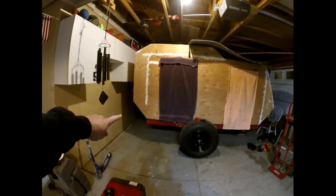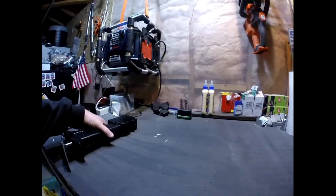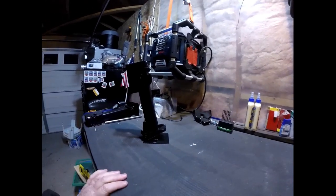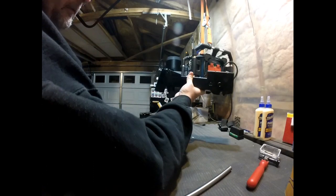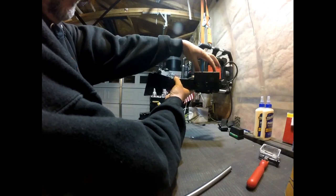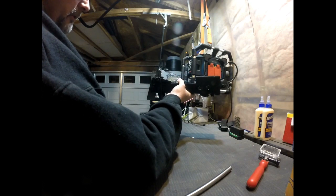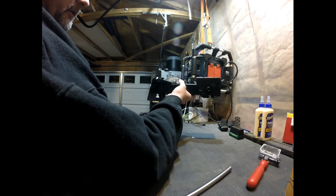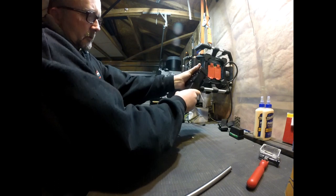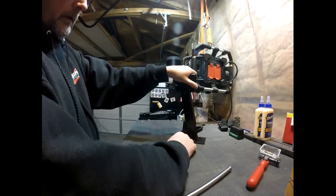We're going to need some stabilizer jacks in the back. So what I found, I think the best option in terms of simplicity and expense are these little collapsible jack stands. The way they work is that you bolt them to the frame, these two holes, and they swing up and they stay up out of the way like this as you travel. And then when you go to camp or disconnect and you want to put these down in the rear so your trailer doesn't do a wheelie, you simply pull this out. It'll be like this, of course, and then the legs come down.